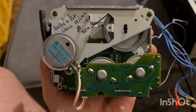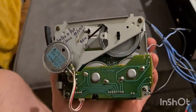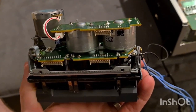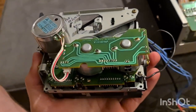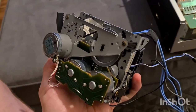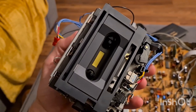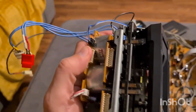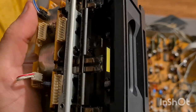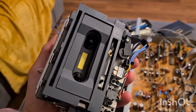What a massive hassle that was. I ended up swapping the switch out with one from a scrap CD player. It's basically a limit switch, and I had a Sony DVD player and managed to swap it out. I've tested it with a multimeter and it seems to be working. So I've rebuilt the transport again, and fingers crossed this is going to be successful. I'm so confident it's going to be successful that I've also replaced the light cover inside — this blue LED that lights up where your tape sits.